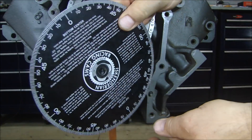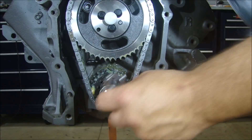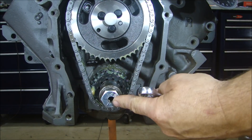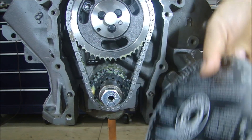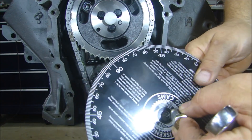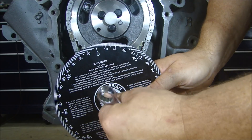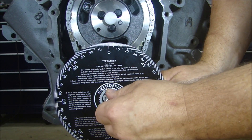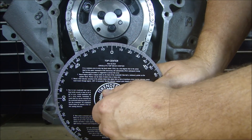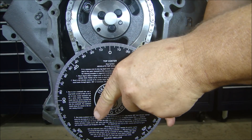Most cam wheels don't come with a giant hole in the center, but the hole in the center of this crank is huge — it's like a three-quarter inch thread. So all I did was drill and tap it to 7/16-14 so I can put my cam wheel on here. Since I have number one at top dead center, I'm going to put the wheel straight up and lock it down just to hold it in place.